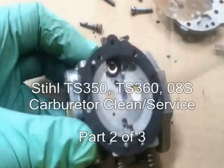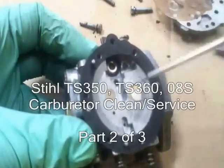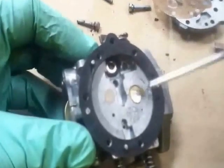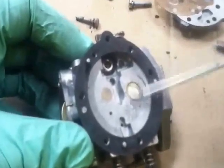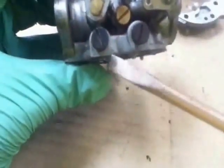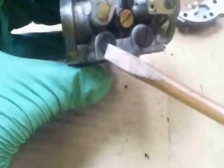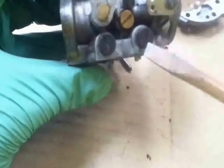We'll drill a little tiny hole through it and fish it out, then replace the core plug — on this occasion I won't again, because a lot of the time we don't really need to take that out, but there's sometimes dirt behind there. Now we'll take out the jets. You'll see on the jets that there is an L and an H — that's to set the mixture for the low speed of the machine and the high speed of the machine.